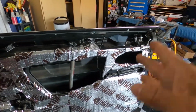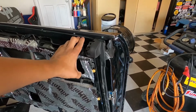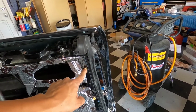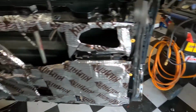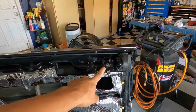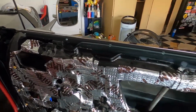So you really want to have all that stuff in. Before we get started, quick rundown on the door panel. We're putting these door panels on today, but you also want to have these clips here. A lot of people will just run screws to their door panels and forget about these guys here. Make sure you guys buy these little inserts. It's basically like one of those anchors you use on drywall, but little plastic guys, and you want to have 6 of them, 3 per side. And another thing, you want to have these guys. This is what your actual door panel sits on, so don't forget about that. Obviously you want to have your window regulator in, everything ready to go, your door lock, weather stripping and all that.